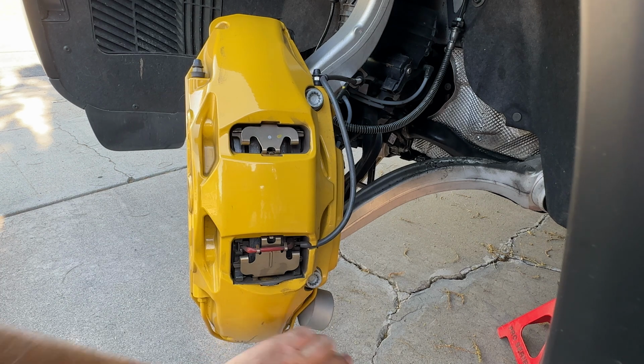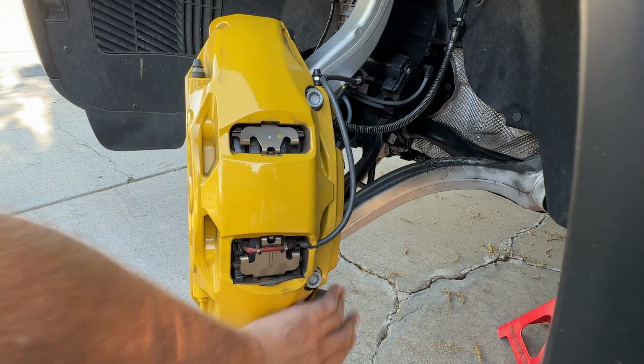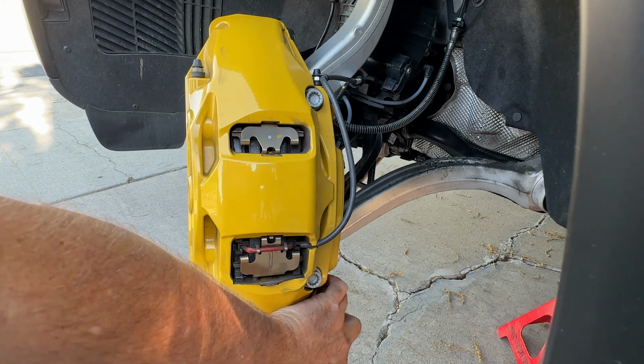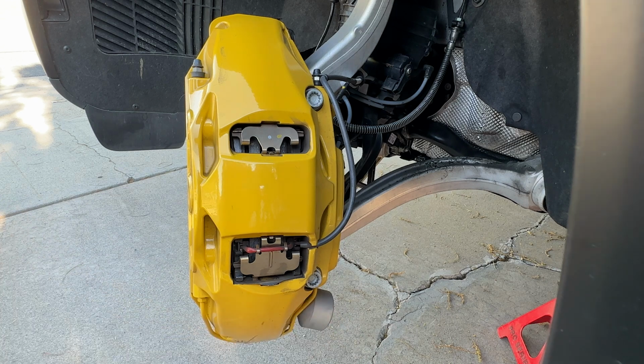Anyhow, this is interesting. This is just a piece of steel that has been bolted to the caliper. It is a mass damper that helps quell a certain frequency of vibration they were trying to get rid of. So adding a bit of mass changes the natural frequency and basically can spoil the natural excitation that can happen if the frequencies align. So change the frequency and get rid of the sympathetic vibration.